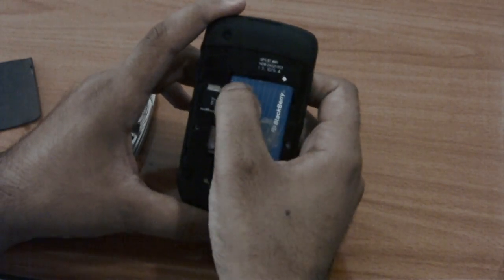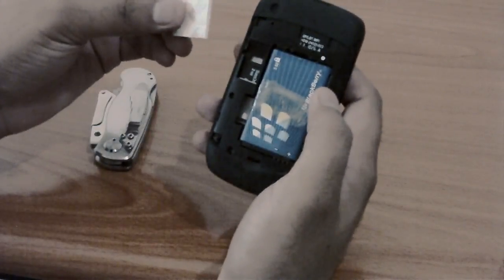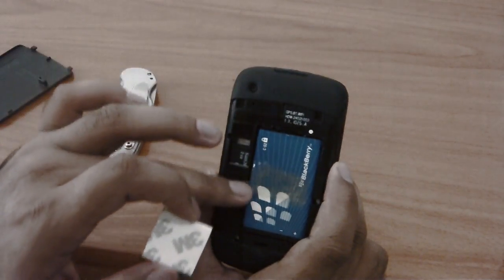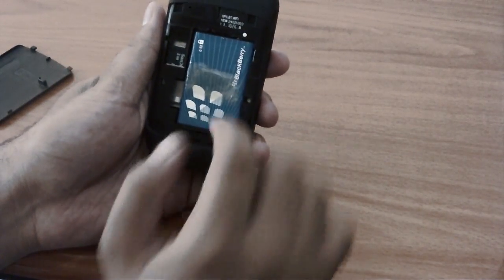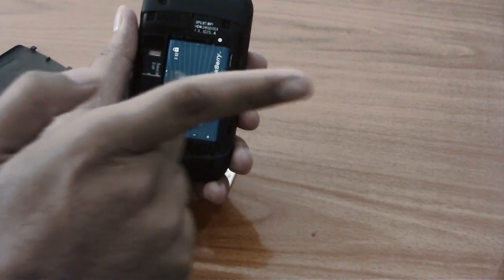So here we go. The problem is that this battery is not tight enough. What we are going to do is take this double tape and put it on two sides. We could do it this way and this way, or we could do it on the top and the left side. We cannot do the bottom because we want the battery to press down, and the best way is to do it on the left so it's pressing towards the battery's right, because the battery connectors are over here.